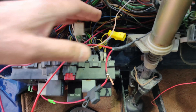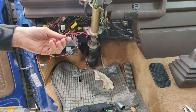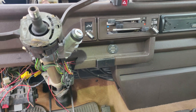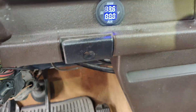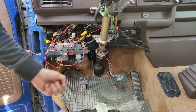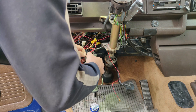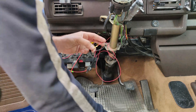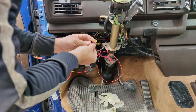I'm going to feed the auxiliary battery from this wire and the main battery from the black and yellow wire. When connecting this it's not working, which means it's for the auxiliary battery. When I connect the main wire it turns on and the voltage reads 13.6V. I'm going to solder this connection and that one as well.